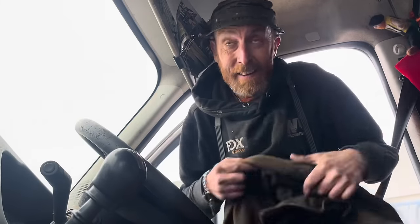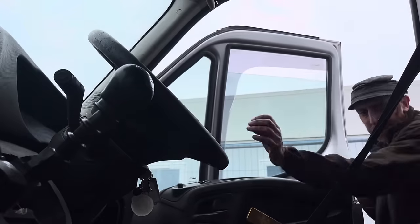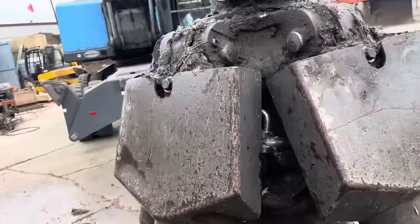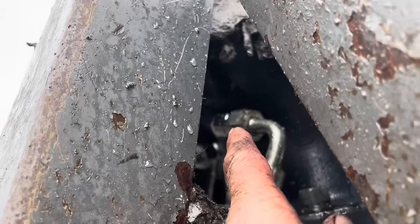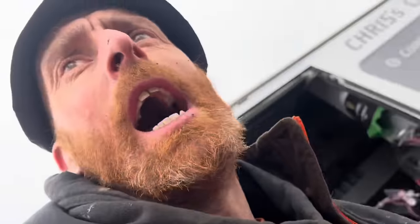It's going a bit chilly now. I've done that oil leak on that foops, now I've got an oil leak on this other foops. He's just steaming it off - it's in a light now and I'm freezing cold. Exact same problem with this one - that elbow's loose there, but you need to crack it all off to tighten it all up. I had to crack off that, undo the elbow, tighten the inner one up and then tighten the bolt. It's complicated - you can't see it in there, I can't get the camera in.